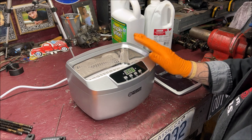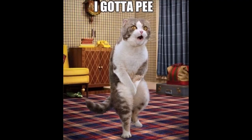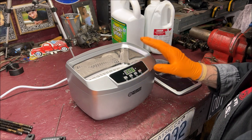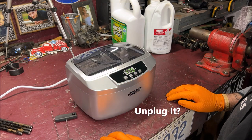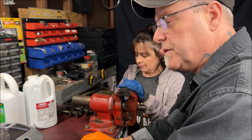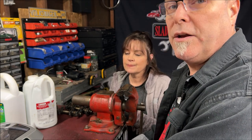When you turn it off, wait a moment — or better yet, just unplug it — so the electricity de-energizes out of the water. Especially if you're in a noisy garage and might think it's off when it isn't. Always practice safety. Now pour the chemical in first — the Simple Green. For heavy-duty use it says half a cup per half cup of water. I'm going to mix a reasonable amount. Heather was nice enough to bring up warm water to give the heater a head start.